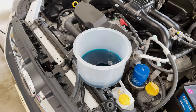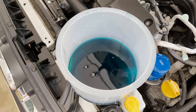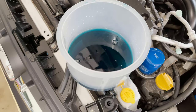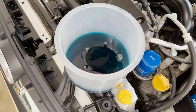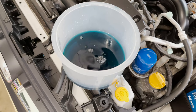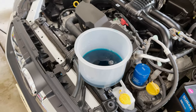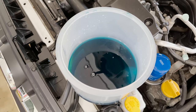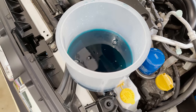Then put the air intake back in and go on a test drive. Once the engine is warmed up, floor it a little to really get that water pump spinning and flush out as much air as possible. I recommend keeping the coolant in the back of your car for a little while — after drives, go ahead and fill it up. Remove the radiator cap, fill it up, and make sure the reservoir is filled up to the full line as well.